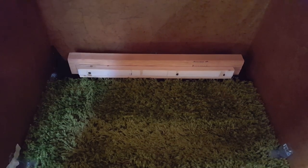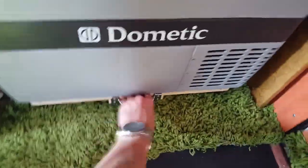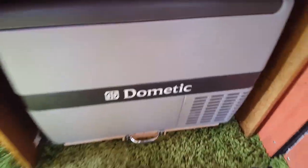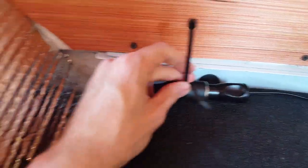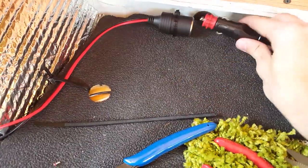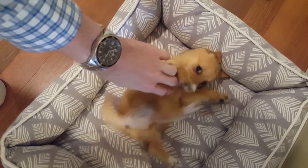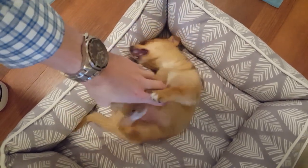It's a velcro bar with wood, and you just roll the fridge back and it locks in. Underneath the bed is the power plug — I wired a female 12-volt adapter to the fuse box. Some people cut open the fridge's official 12-volt adapter and wire that directly into the fuse box, but then you ruin the plug, so I definitely didn't want to do that. I've got another video coming up that should give a good example of why that's a bad idea.